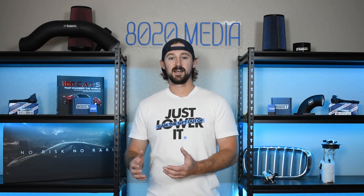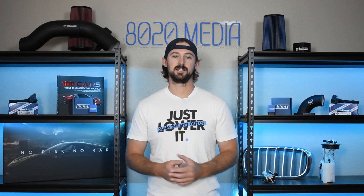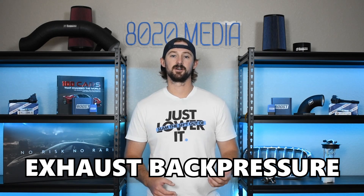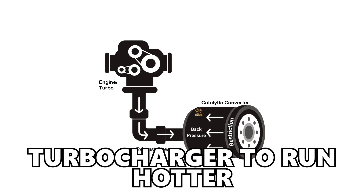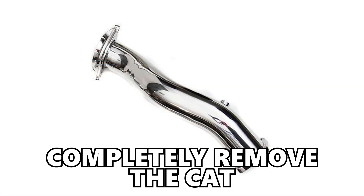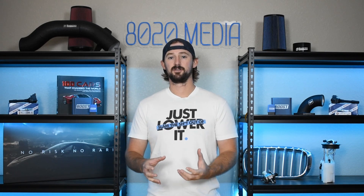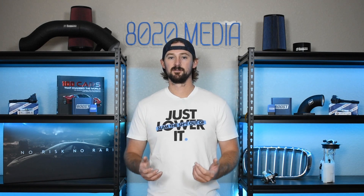After an intake, we're going to look at the exhaust system. Once we're bringing more air into the engine, we want to get that air out. The most restrictive part of the exhaust system on the 4B11T is going to be the downpipe or front pipe. The front pipes are where the catalytic converters sit in the Evo X, and the catalytic converters are naturally highly restrictive and create a lot of exhaust back pressure. This back pressure acts as a force against your turbocharger — it decreases turbo spool, causes the turbocharger to run hotter, and decreases efficiency. By upgrading the downpipe and front pipes — either removing the catalytic converters entirely or getting high-flow cats — you can significantly reduce exhaust back pressure, lower your EGTs, decrease heat, and free up turbo spool, leading to about 10 to 15 wheel horsepower gains.